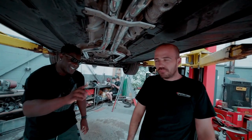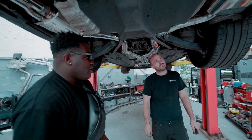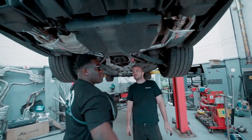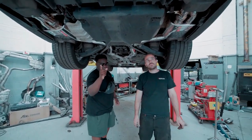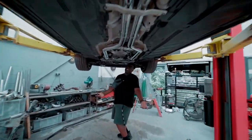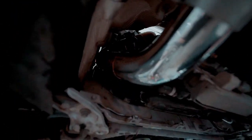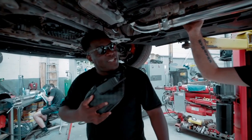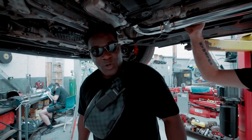So there's a lot of R&D involved, and we were the first people to have the E63 S, so we figured it out. A lot of people in America have just figured this out — but something along here goes, and there's too much power, and it throws it into limp mode and it doesn't tell you it's in limp mode. So when you find out, let me know! The pipe is 3-inch all the way back — because it was 2.75 standard. I might be able to start my car quiet now and not wake up the neighbours. Not that I give a shit about the neighbours, because they've all got Porsches and they wake me and my kids up — so we have it out!